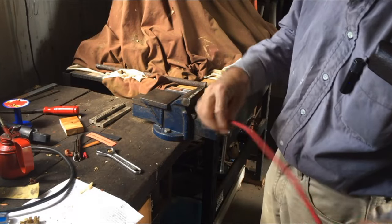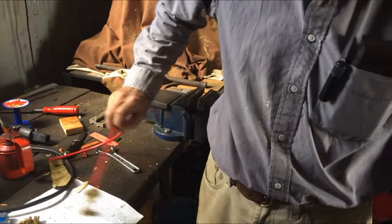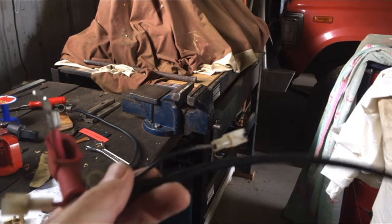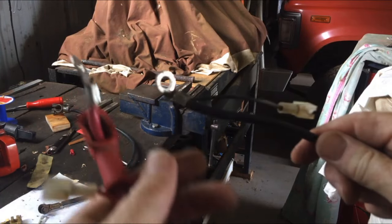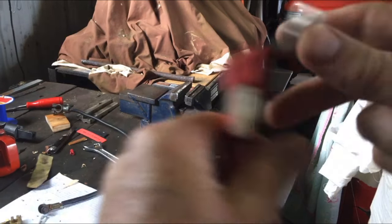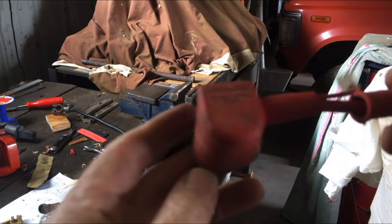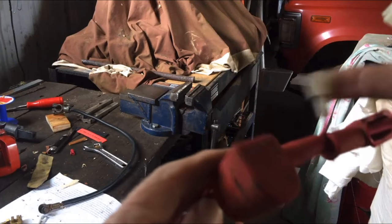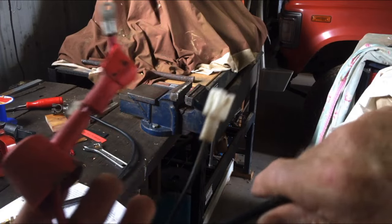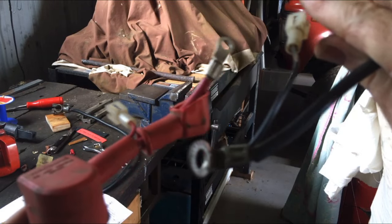I might just check over on the mower what's on the other end of the lead - maybe I can replace the whole lead without having to join them in the middle. I took both the negative cable and the positive cable off the mower. The negative's got this little tail at the bottom that grounds something else, and the positive got the same thing. That was the battery end and this was the vice versa - that's got a little connector plug. So if I make two replacement cables with the right ends on them I'll have to adapt those two little connectors somehow.